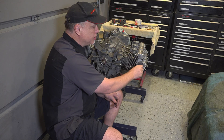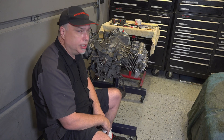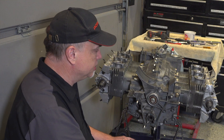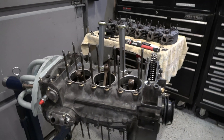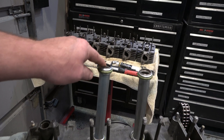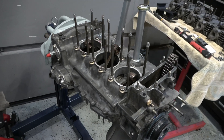The second cam is the same story — it spins really freely. I don't have a torque gauge but it feels very free, not binding at all. Now I have to take it completely back apart. The spigots look pretty smooth but I'm still going to put the Yamaha silicone sealant on those things — probably on both sides of the gasket. I'll also need to put in the oil return tubes and heat shields before putting the cam carrier on. Everything looks pretty good, ready to go together one more time.